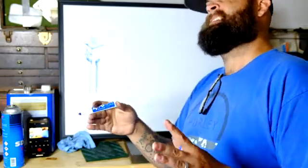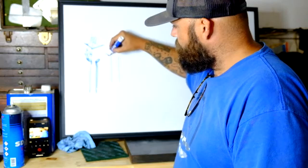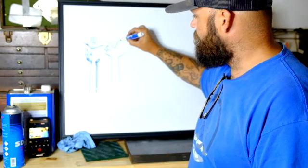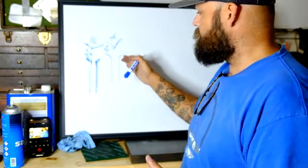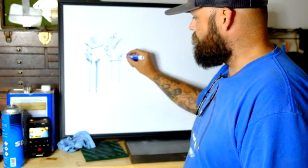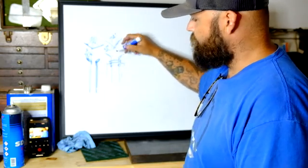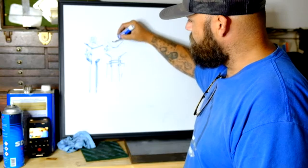AN is different — it's 37 degrees, and the math on that is like 74 and some change. With AN, your brake line comes in and you've got one 37 degree angle — if you're measuring it here, this angle would be 37 degrees. And it's only a single flare because with AN, you've got a nut and sleeve that goes on here and receives this angle and helps bury it into its receiving end.